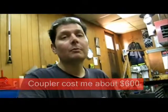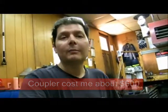Even as a group, say two or three people that want to get together and make an electric car — help each other out, make one for one person and he helps you make yours. There are some things though I would suggest getting a professional to do. For instance, making the coupler that joins the electric motor to the transmission. I had an amazing gentleman help me make the coupler — those parts have to be spinning at 3,000 to 4,000 RPM, so you want it to be as precise as possible. I had a machinist do that. Everything else we can work on in the shop — weld battery boxes and so forth — the electrical is pretty much basic stuff.